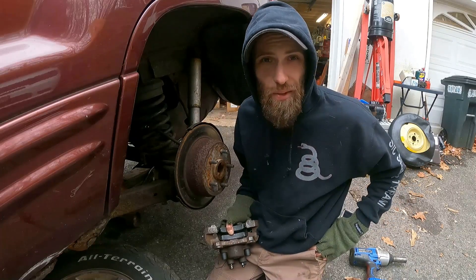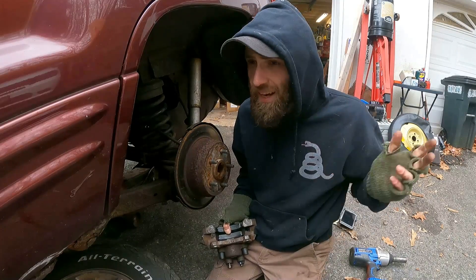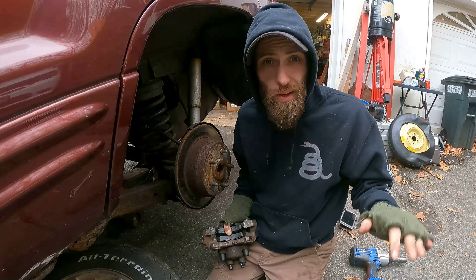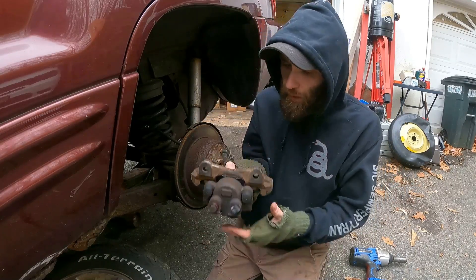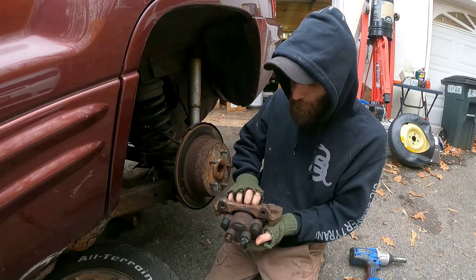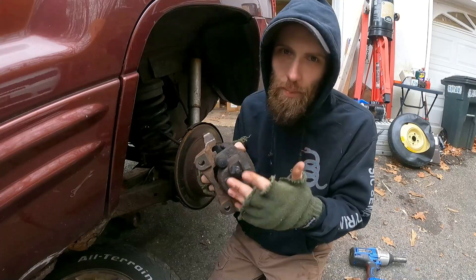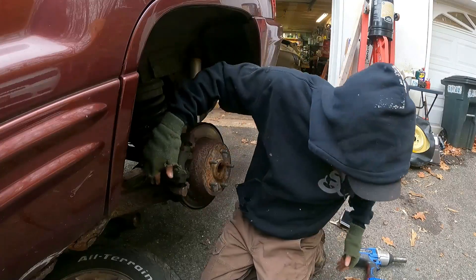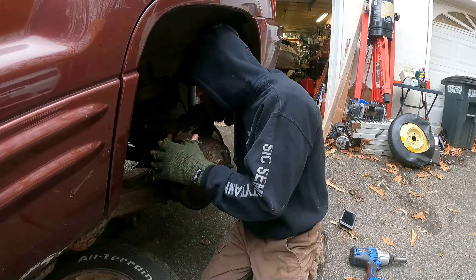That was fun to edit with no sound. Thanks for joining me and making it to the end. I'm coming to you on my brand new to me GoPro 9 — I couldn't see spending $500 on the 12, so I got this open box 9 from Best Buy for a song. Let me know if the video and audio look better. What I do know is definitely better than before is this here caliper — I've got to reload it with some CarQuest Platinums, about 50 bucks for the pair. When you're putting your calipers on, everybody knows this: your bleeder's got to go on top. The bane of shade tree mechanics everywhere — those darn bleeders. Make sure the anti-seize is on your mounting hardware from before.